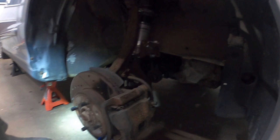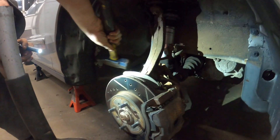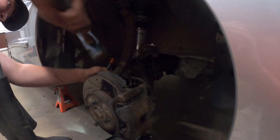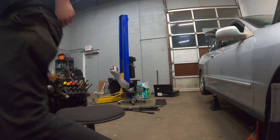While we still have the front up in the air, Chris, give them a quick runthrough of what you have to do. So you got to pop out the upper ball joint, disconnect the sway bar end link, do the two top bolts - the two top hats - and you're good. Chris works at a Chrysler dealership now so he thinks he's super cool and doesn't like Japanese cars, but just a couple months ago he had the coolest Miata around town.